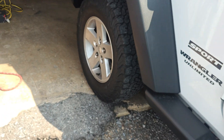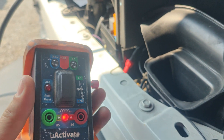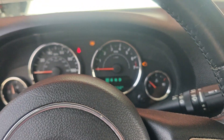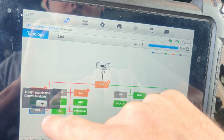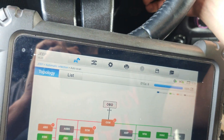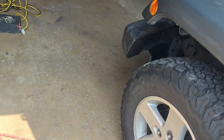What I'm going to do is get the Uactivate and test this. Let's turn the key on — I got my Uactivate on. You can see it's controlling it. Press this, we got power, so let's turn 87 on and see if we can talk to our TCM now. We still can't talk to our TCM even with that one. I was hoping that would have done it, but maybe our fuse or something is blown.